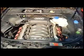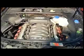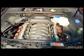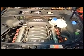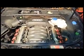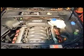The B6 S4 is a great car, but one of the things you really want to do when you get one of these is do a compression test. A lot of these motors being aluminum can end up running into serious compression issues — bent valves if the chains have failed, or had an intermittent timing chain guide crack or adjuster failure. So what we're going to do here is briefly walk through doing a compression test and what all it entails, so you can see if this is something you can do at home.